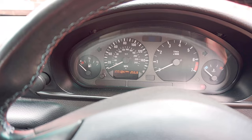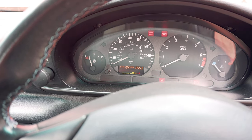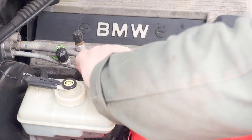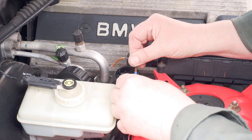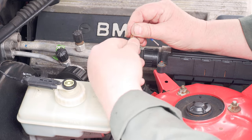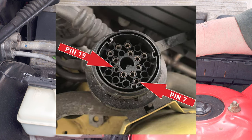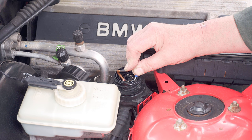I've been taking the trouble to change the filters and the oil and need to reset the service light — still got one green block showing. What you need to do is take the cap off the diagnostics plug and basically earth pin number seven to earth, turn the ignition on for five to ten seconds and then turn it off and that's it, job's done. You can either earth it to pin number 19 which is an earth, or with a wire all the way to an earth on the body — perhaps one of the suspension nuts would be good.